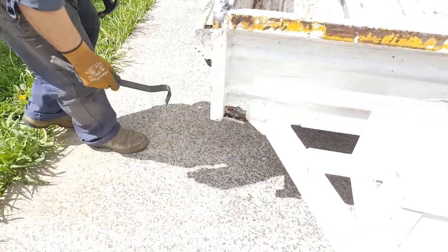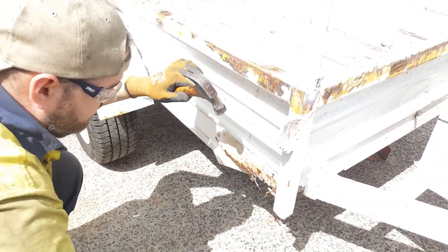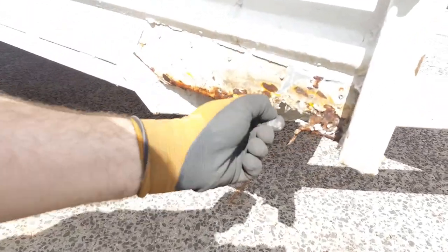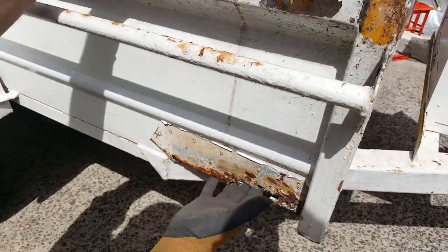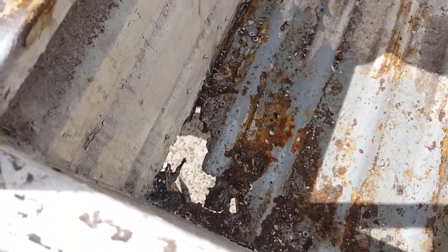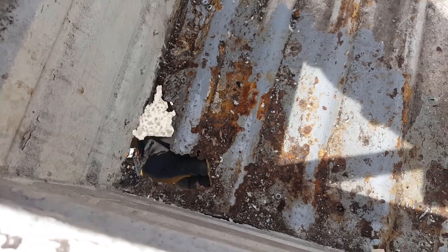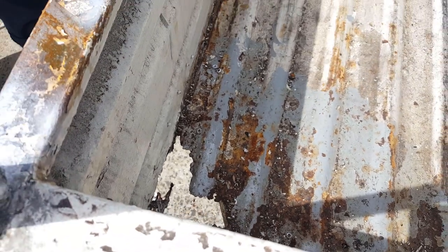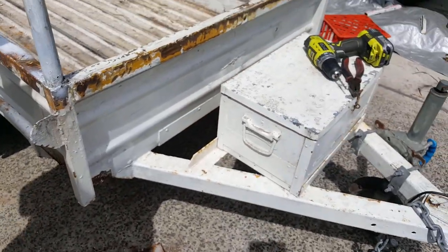I checked — I was going to leave it like this. Look at the top — wow, that's pretty significant. The main rails are here and they don't appear rusted, so we're okay. The support beams are intact. If they were rusted out, you'd have to replace the whole beam. I'll pull this box off and then see what the other repair is down the front.